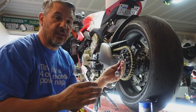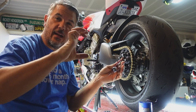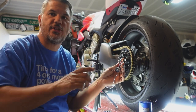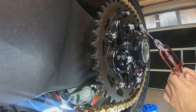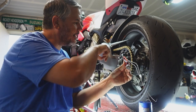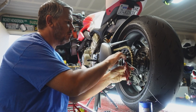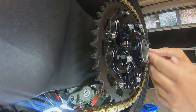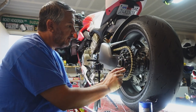I've found that three spins — three pulls of the spinner — gives me the look I want. Two pulls is a bit chunky, three tightens it down nicely, and four will just break the wire. So grab the puller on the back and pull one full turn, making sure you get the full turn. Do three full turns for a consistent look. Then unclick the pliers, and you'll notice the wire lines up right at the next cush bolt, so wrap it around and take it down to the next bolt.